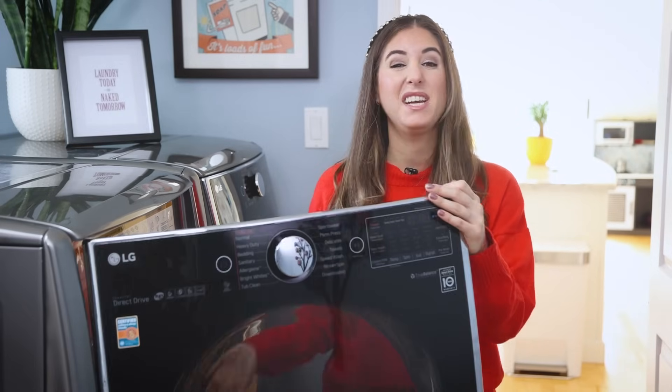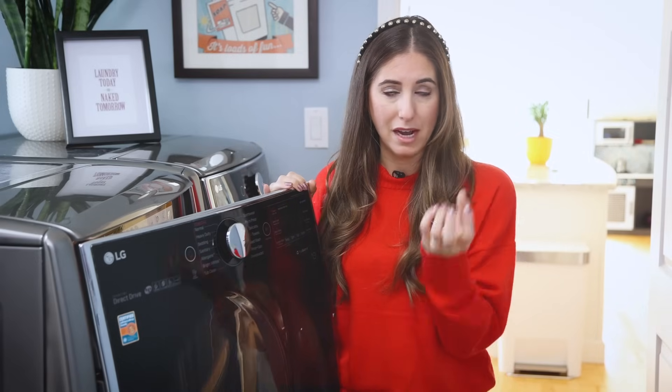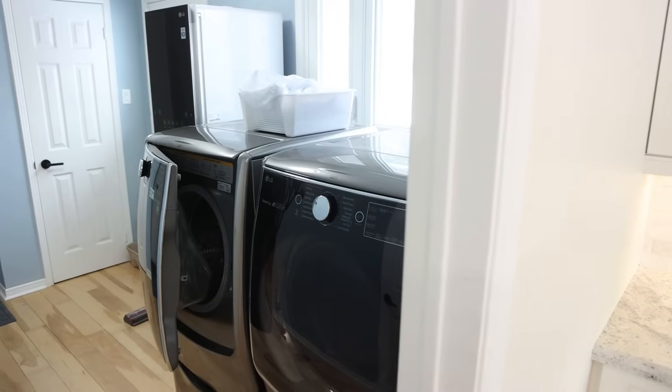I've probably been saying this for 10 years now, but it bears repeating: I get so many comments and DMs about smelly washing machines. Generally, your washing machine smells for one of a few reasons, but one of the top reasons is that your machine doesn't have the opportunity to air out between cycles. There's dirt, excess detergent, moisture — it's dark, it's warm — it's the perfect breeding ground for bacteria, so it's going to reek if the door is closed. The rule should be whenever your machine is not in use, leave it slightly open. That just allows it to air out.